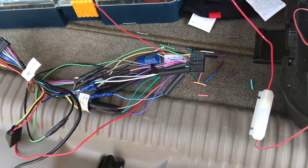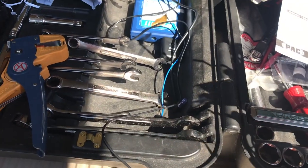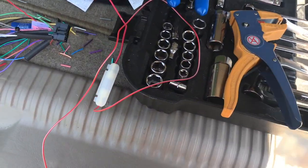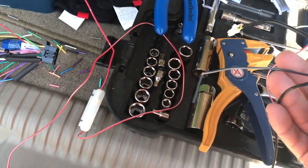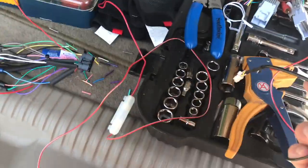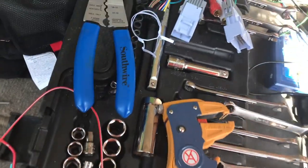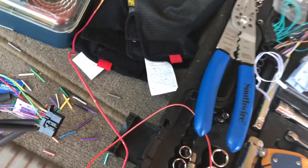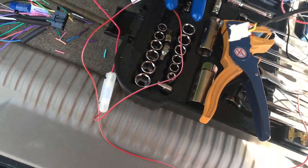Oh, and if you're wondering, what am I gonna do with grounding the camera? Because there is a ground wire. Let's see here. This connects to the other end of the camera, which is right here. Sorry, it's a little sunny to mine, so it's hard to see. Anyway, the connector's on that, and your ground wire is right here. So what I've gone ahead and done is just bundled this up. The ground wire is significantly shorter than the power wire and the video RCA in. So I think what it's basically going to have me do is I'm just going to ground.